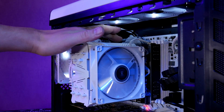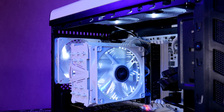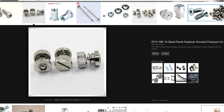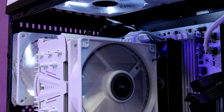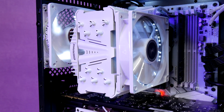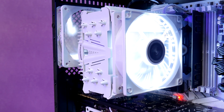Overall I had a pretty good experience with the cooler, though there were a couple of issues, like the need for an extra long screwdriver that buyers may not have lying around. Also the main cooler screws have softer metal than they should, considering the force required to turn it increases as you progress due to the spring. This could have been remedied by making it a large flathead design, or making it a textured thumbscrew would fix this entirely. The other not-so-important issue is just the inclusion of a flash mode instead of a breathe mode, which would be much more suited to sitting beside you long term. Also, I wanted to have white stickers on the fan hubs to really white out the case completely. The Enermax ETS-T50 CPU cooler is an outstanding cooler which not only looks slick, but can also effectively cool all the top selling Intel and AMD chips. With an extremely good cooling ability, a big sized radiator, and a unique white theme, the ETS-T50 CPU cooler scores a 9 on the meter.